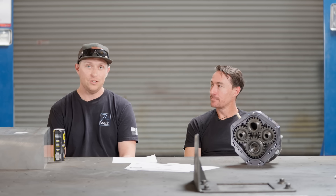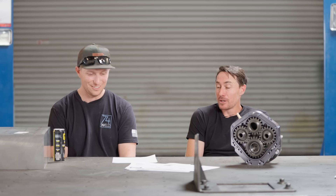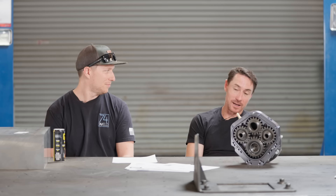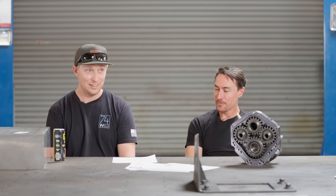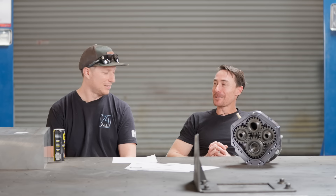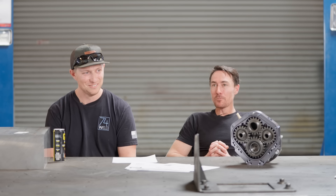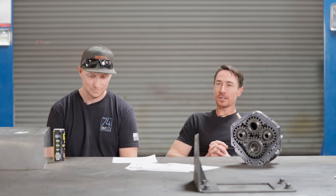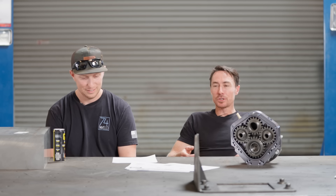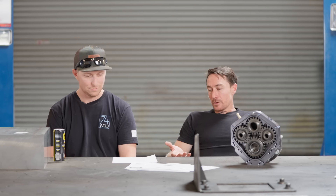The other thing I feel with hydro assist is latency — a millisecond between when you turn the wheel and the response because you have to push fluid down a line into a hydraulic cylinder. It's not a two-second delay but you can feel it. I've driven hydro assist on long road trips and you get used to it, but if you do everything at once and you've never had it before it'll trip you out. I'm critical of it but I do run it and love it off-road — it's a compromise.